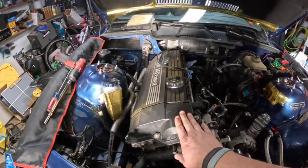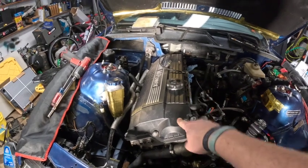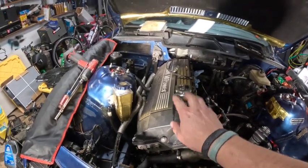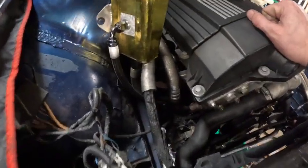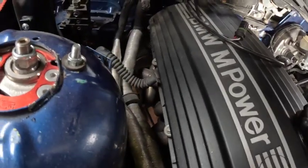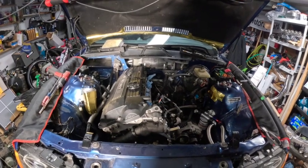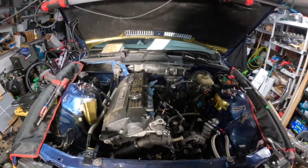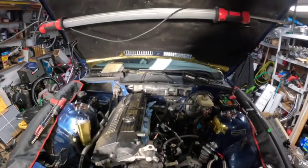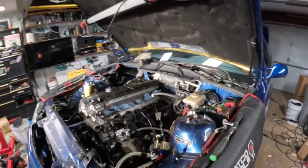The motor is built. It's 11.5:1 compression, forged pistons, ARP rod bolts, main bolts, head studs, 276/270 cams. Snuck down the side over there are some Active AutoWorks long tube headers. And all said and done, this setup made about 321 wheel horsepower and about 260 torque, redline 7200 RPM. Super fun combo, but I am now taking this to another level.